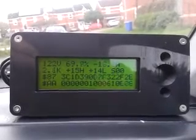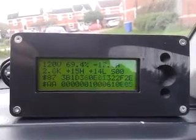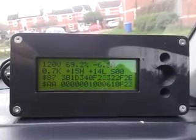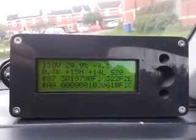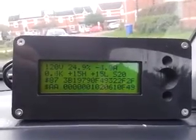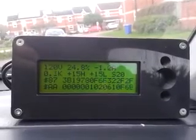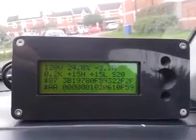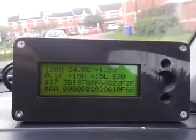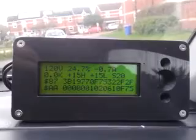Going down and down — and there we are, that's assist finished. It fades away. There's about 10 volts of headroom at the bottom so I possibly could squeeze it a little bit lower. Assist falls away and what I need now is for it to automatically start a charge cycle so it actually starts to add a little bit back to the system.